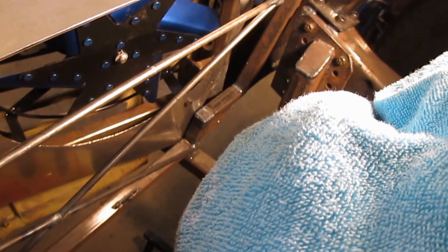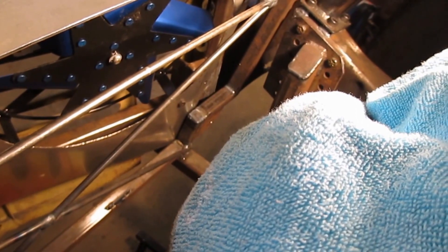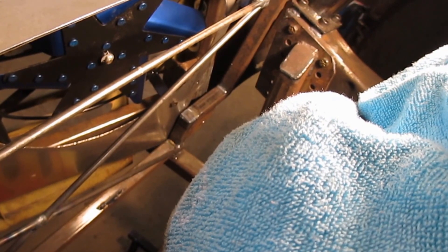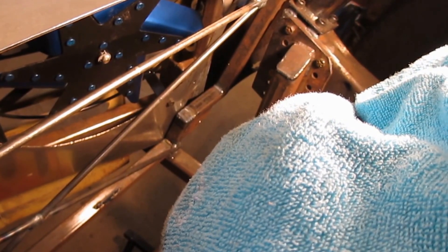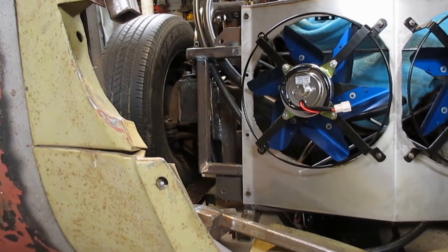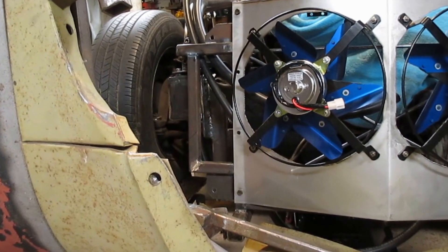It's a little bit hard to see, but it's awfully close to the one-piece front end. I've got about a little more than a quarter inch in there — it should be okay to adjust the front end and still get the hood to line up. You can see where I'm gonna run the hoses off to the side there on the left.